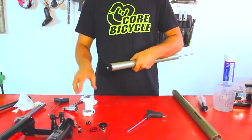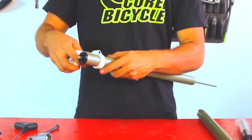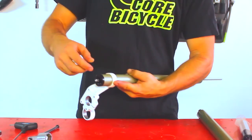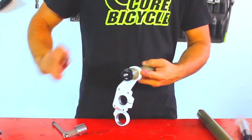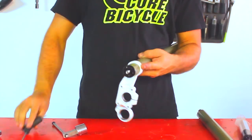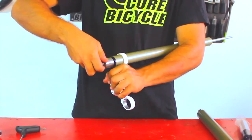If you can't loosen the cap because the whole tube is turning around, use temporarily the fork lower crown and tighten the tube more or less at this distance. Tighten the clamp bolt a little bit and remove the fork cap.